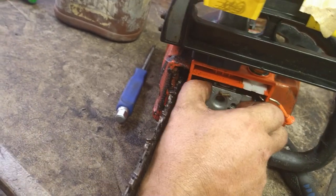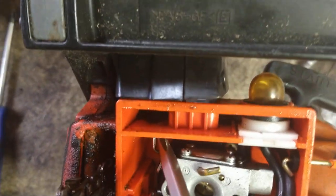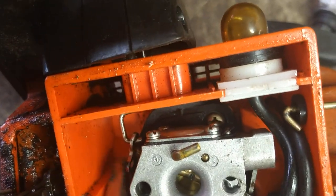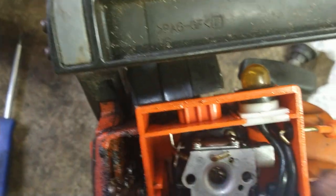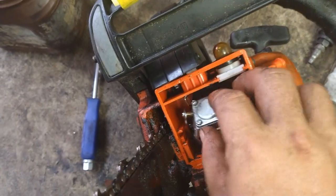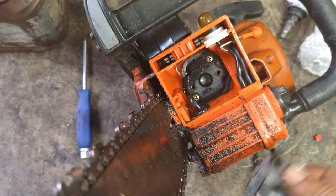This choke arm is going to get pulled out. I'm going to pull all this out. There's a throttle arm in here — need to force that to the side, and she'll just pop right out. It helps with two hands. It's on the top of the little triple butterfly-looking thing, on the very top. It pops right out — just had to pull this forward once I pushed that down. And when we put this back in, we'll push that way, push this in, and line it up until it pops back in.